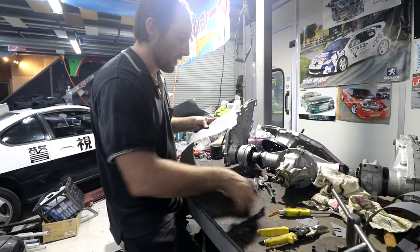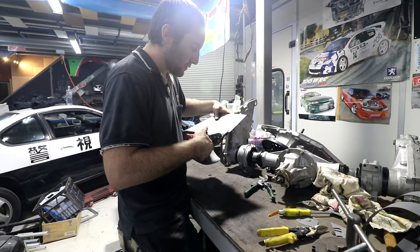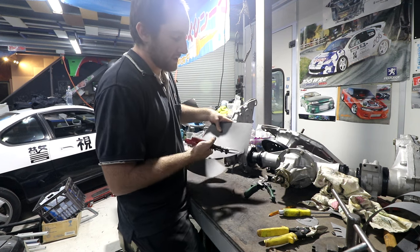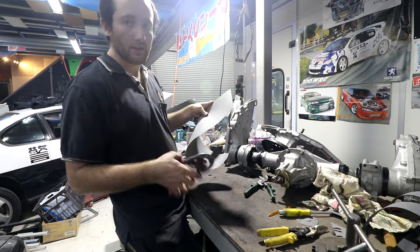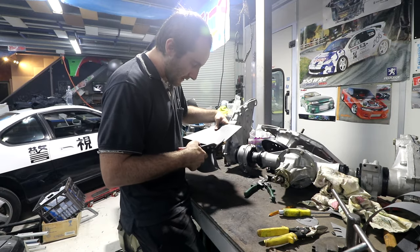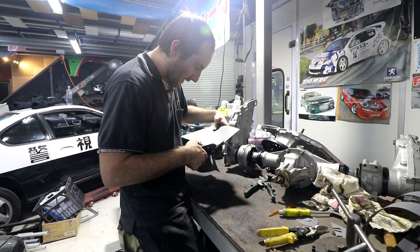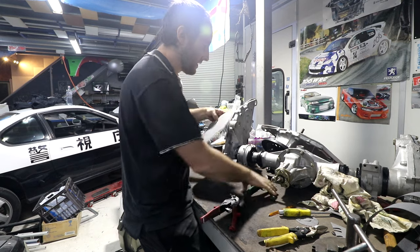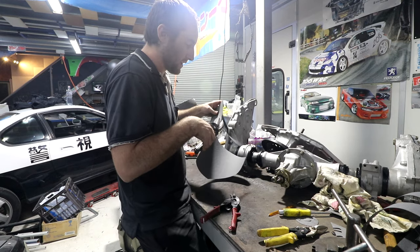So the left and right ones make a big difference. And I just forced the red ones to make a right-hand cut for a second there, which is alright. But then the little curve where they go left, it just glides through it. So much better than a pair of regular scissors. Everyone should buy left and right-sided tin snips. This isn't just a conspiracy from Big Tin Snip to sell you more tin snips. It makes a big difference for which way you want the cut to go.